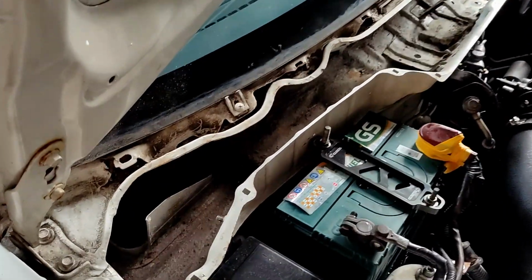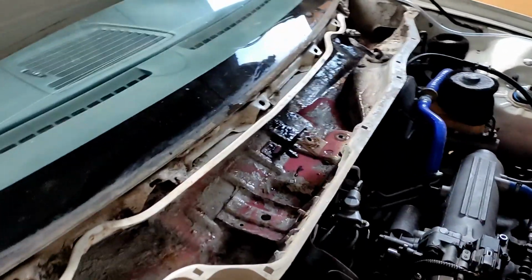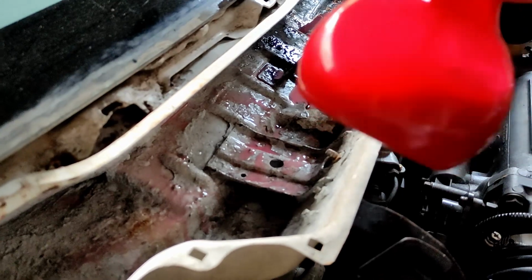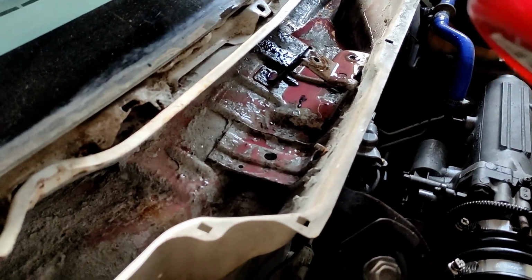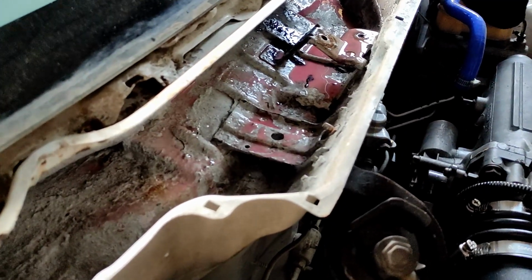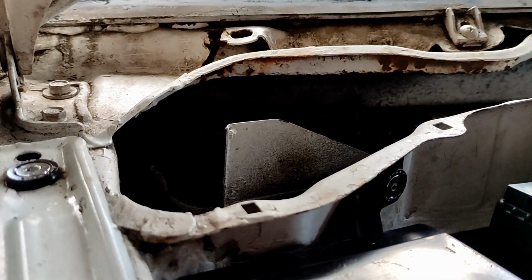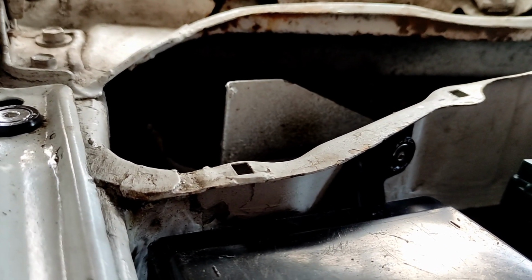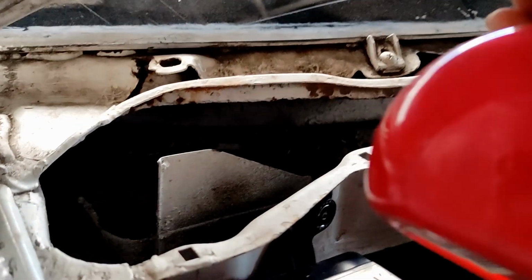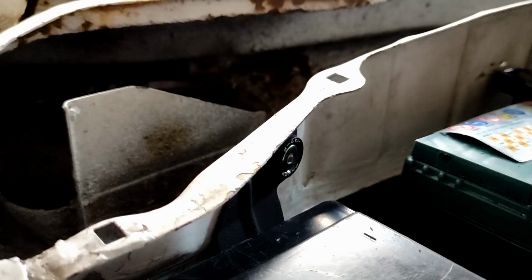And it's raining now. Holy crap. So I already started spraying some ATF, ATF mixed with liquid soap. Some say they're using Dawn. You can view that on other YouTube channels. It's really hard for me to clean all the rust or remove all the rust and then repaint them, because you have to flip over the car, put it on a rotisserie, but I don't have the budget and time to do that. So I'm gonna use the ATF first while I'm saving up some money for the restoration.